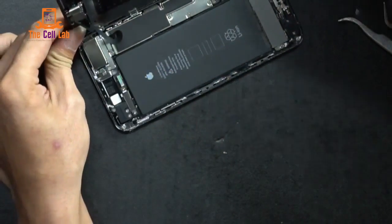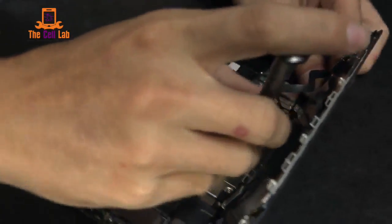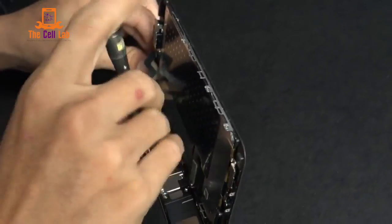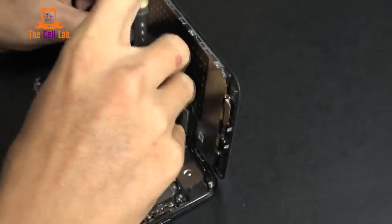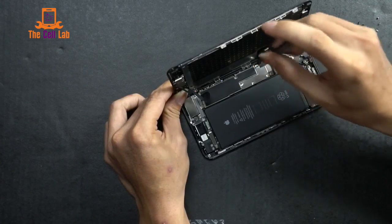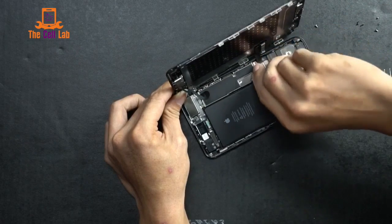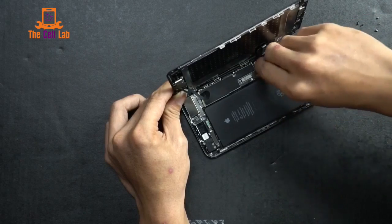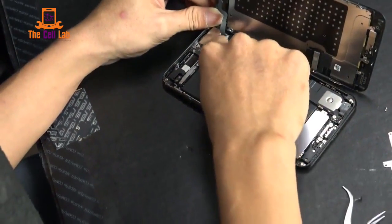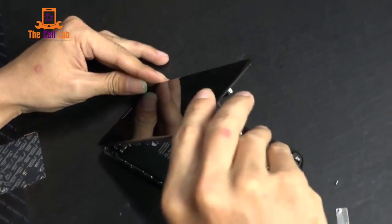Now we have this open. You can see the battery is the same as always. There's definitely a different heat shield on top of the LCD, and if you'll notice, look at the plug-ins — before they went from the top of the screen down, but this time they're on the left side of the screen, which is pretty nice. I'm taking off the heat shields first to get a look at what's underneath. I'm guessing where all the flex cables connect into the logic board we're going to find those same Lego-like connectors. And bam — our first heat shield comes off. This one covers the battery and also the home button assembly. Up in the corner we have our vibrator piece and our new speaker.